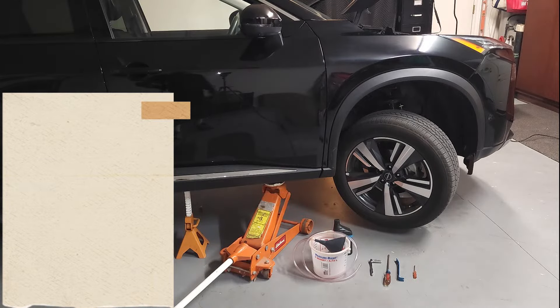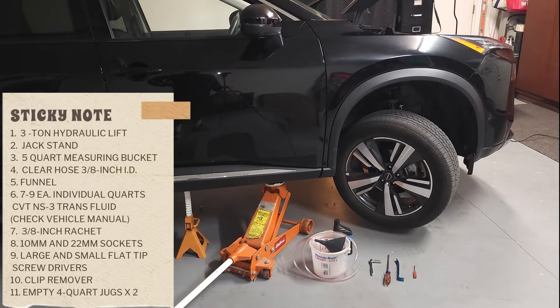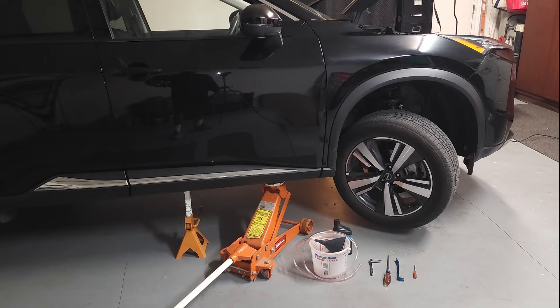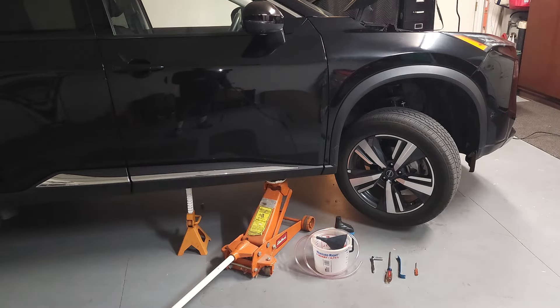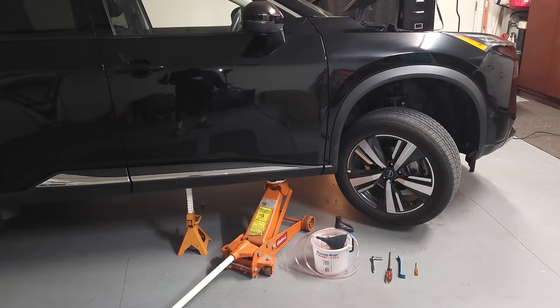Our supply list includes a three-ton hydraulic jack with support, a five-quart measuring bucket, clear hose and a funnel, seven to nine quarts of Nissan CVT fluid NS-3, a small ratchet with a 10 millimeter socket, a large flat tip screwdriver, a clip remover, and a very small flat tip screwdriver. Please see other items in the description below. The drain and fill method described in this video uses simple subtraction and addition to drain and fill the transmission. It does not include a filter change. This video is for educational purposes only. Please refer to your manual for specifications and warranty details.